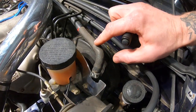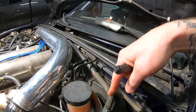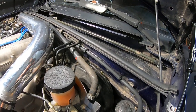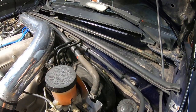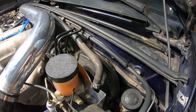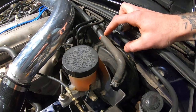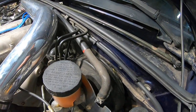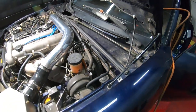Important note on this — there is a one-way check valve in this line. So you don't want to just run your own custom line all the way across. This check valve is important: it basically holds vacuum and brake assist if the engine is off. So either if it stalls, you'll still have power brakes, you'll still have assist from that. Or even just when you turn off the engine, if your foot's on the brake, it'll help hold the brakes. So it's an important convenience and safety feature. We just used a junction here to connect the custom line that we put in and cut off the stock line there, keeping the valve. So important detail on that.